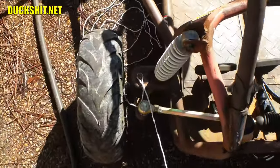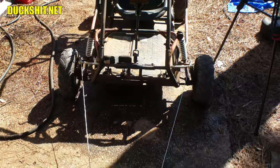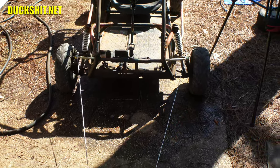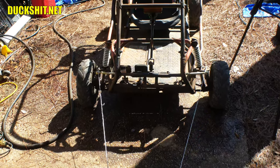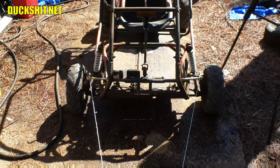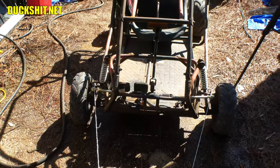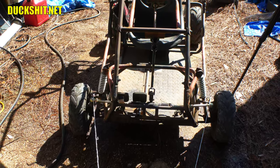The same thing goes on the other side — the exact same measurement. That string belongs right there in a straight line, so this whole ball joint needs to be moved over. Now we know what we need to do, and it isn't all that hard. I'll bolt the adapters on rather than cut and weld, because I don't want to monkey with the geometry of the existing steering knuckles. This way there's less risk of making a mistake.